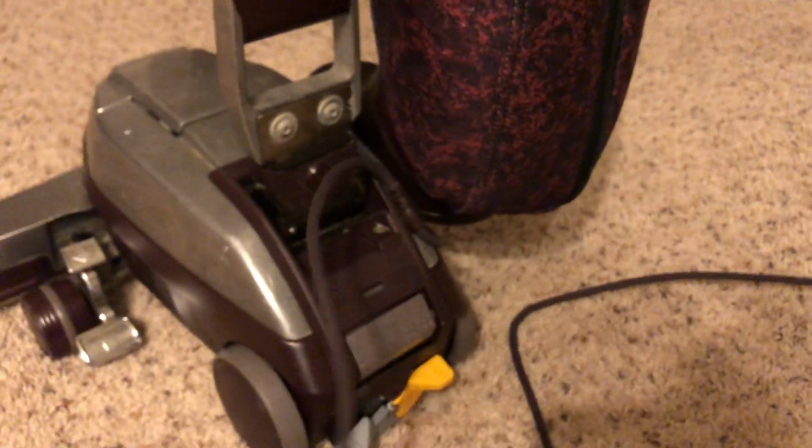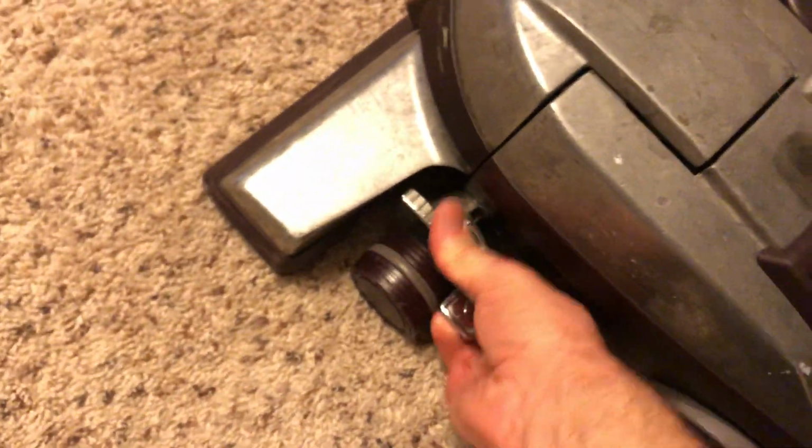And you also do have one more attachment. What this is for is while you have your floor head hooked up, or you can even have this used on your hose attachment too. What you're going to have to do is detach your little cord hooks at the head of the vacuum. Let me see if I do this right on camera. So what you do right there, push this little tab that holds your outer bag in place in the handle, push down here, that releases your handle from the vacuum. And then you can simply attach this little hand tool right to the base of the vacuum and attach your bag right into there. And now you can use this as a portable hand vacuum.